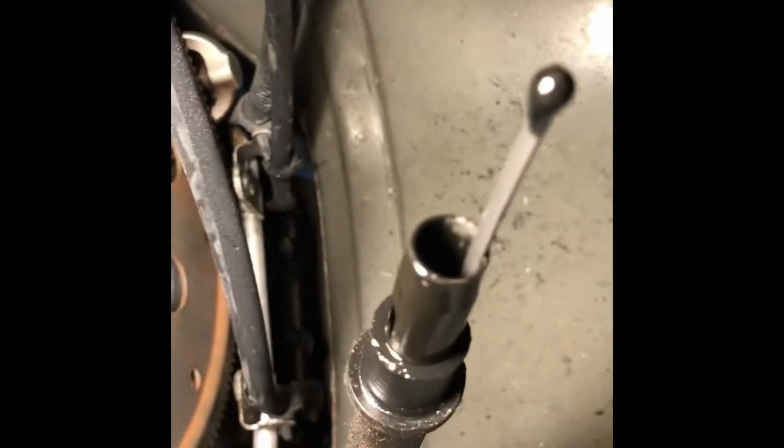Clean off that oil dipstick tube before it goes in, but just kind of get everything prepped out of the way. So in addition to getting that line taken care of, I also have, where are you, feller? One of these lines had, oh, here it is. I gotta get the old neutral safety switch out. I guess it's like glued in. I knew that from the white clip right there that was glued in, but the guy at the training shop just said take a bunch of heat and heat it up.